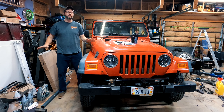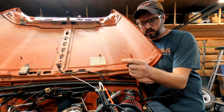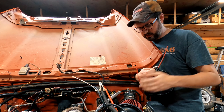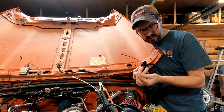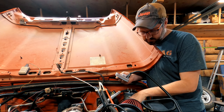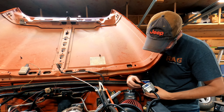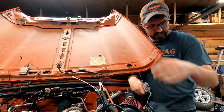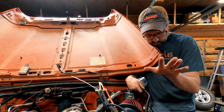Here's how I'm going to hook this up. These two wires hook to the back of the terminal on the XJ alternator, and it doesn't matter which way they hook up — which is a huge relief, I did double-check that online. This wire needs to connect somewhere that is key-switch-on, so that's easy enough. I also have to ground the case to both the negative terminal of the battery and the case of the alternator. Right now it's looking like I'll mount it right here near the fuel filter — it's a good spot, away from the heat, and gives me good access to run the wire for the key-switch-on and to the alternator.